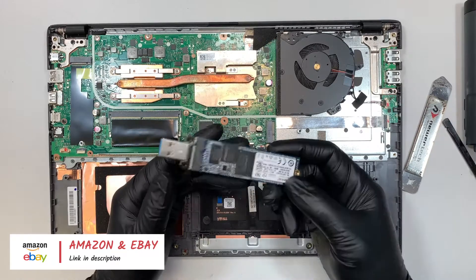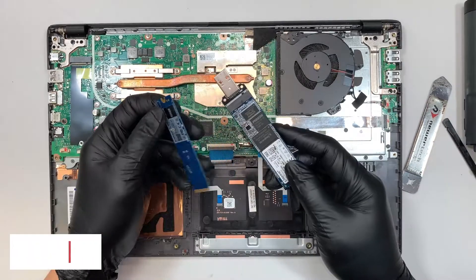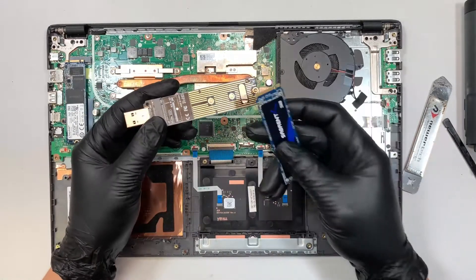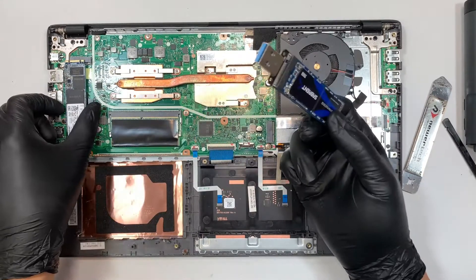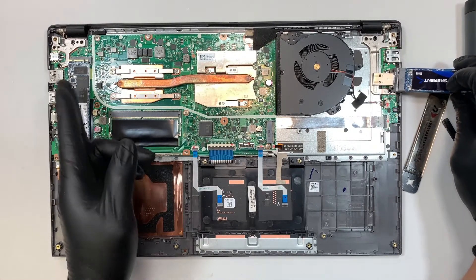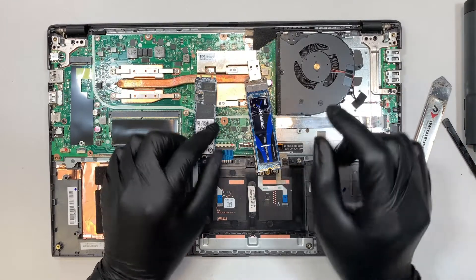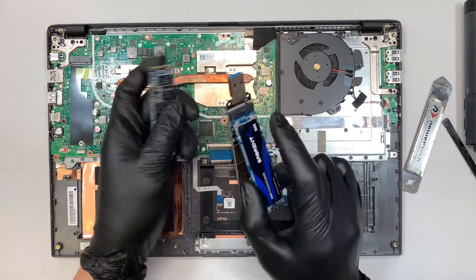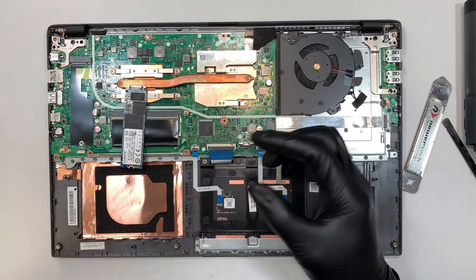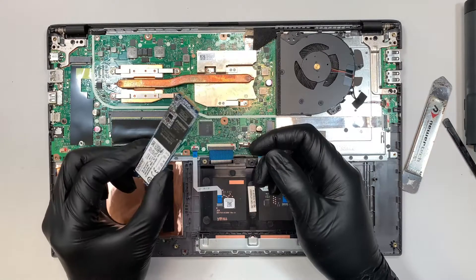For those interested in upgrading your current hard drive to a larger drive, you need another M.2 drive and a USB adapter. While the original drive is still inserted, get a larger drive, plug the adapter into your USB port, and you can clone from the original over to the larger drive. I'll make a separate video for that — I'll link it in the description and try to link it at the end of this video too. Click the box and I'll show you how to clone from one drive to the other.